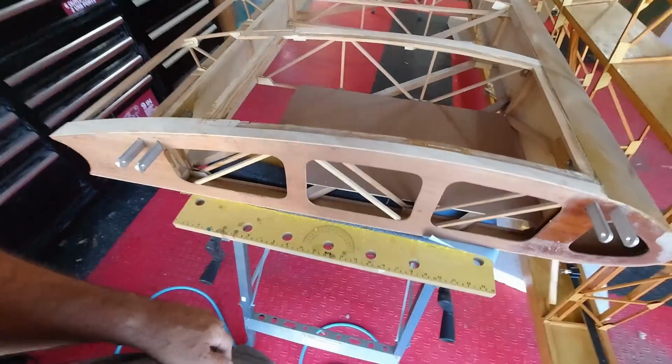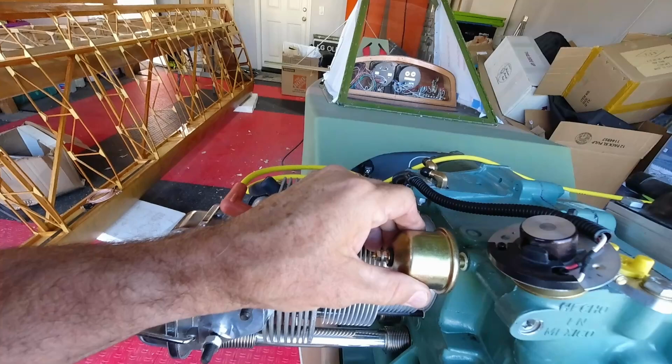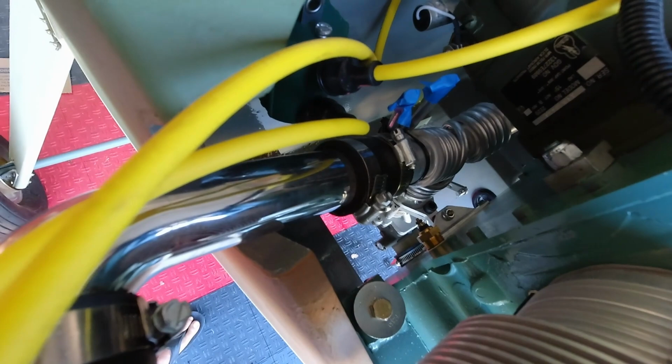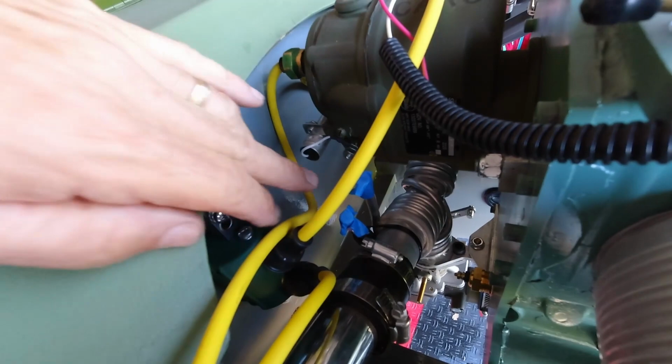I'm also going to work on connecting some more stuff up here, the oil pressure. We're going to connect the oil temperature, which is down there on the bottom. I want to get that connected. I have my secondary ignition, and the goal was just to run all these wires at the same time, and then we've got the P lead on the magneto that is going to get wired to the switch, and then that's going to go to ground,